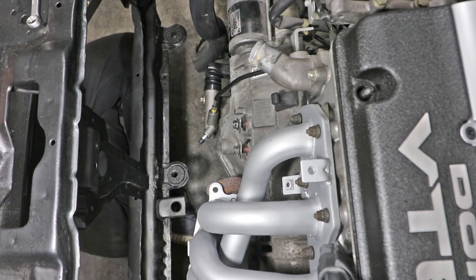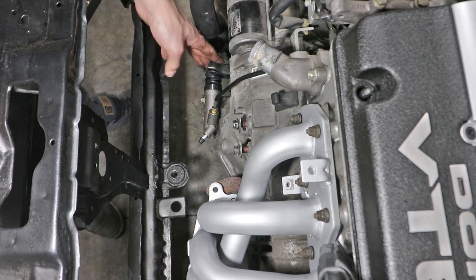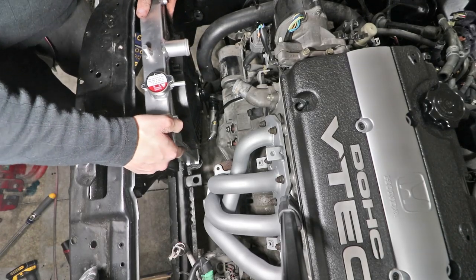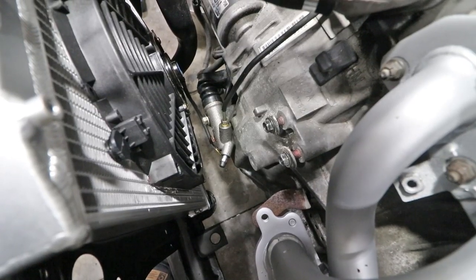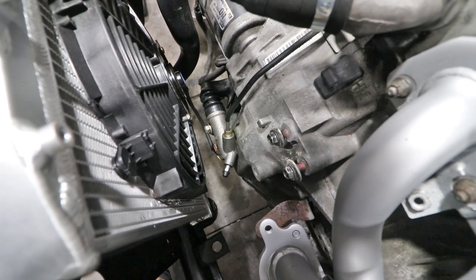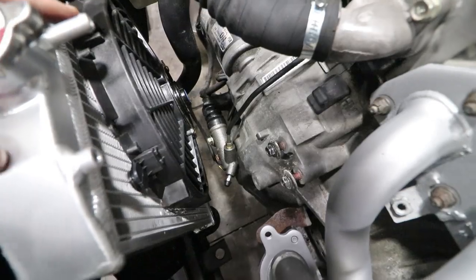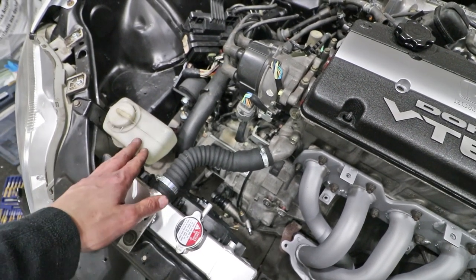Also easier just to take off the front bumper. Now that everything is tightened down we can go ahead and reassemble everything so we'll put the radiator back in. So there we are with the complete installation of that Integra slave cylinder. A little bit of modification to it but definitely something that will stay away from those fins on the fan on the radiator, allowing me to keep it still as a pull system. I also got some hoses finally — this one just came in and it's like a flexible hose that I was able to cut down. Got everything fastened in, I got the reservoir in there, still need that little tube that connects from here to here. I want to actually get the car jacked up on those wooden planks that I made a long time back, like in the very beginning of my episodes when I was doing body work, just because I need more height underneath. Also it'll be easier for me to get that gas tank installed as well.